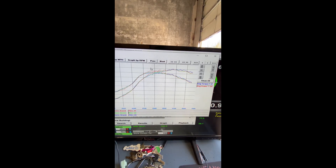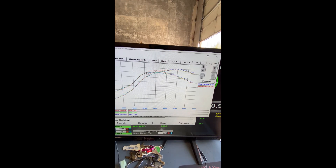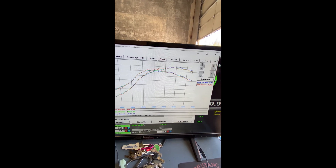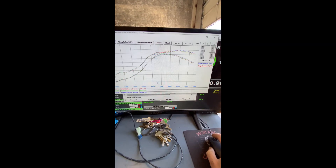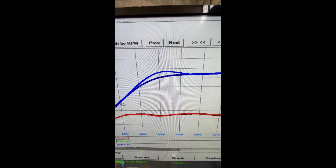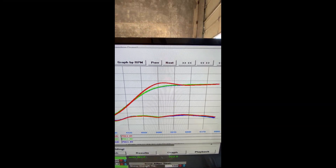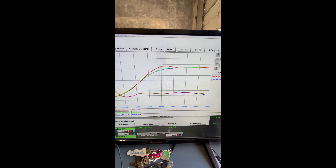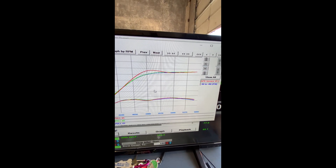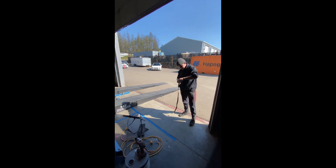Instead of it peaking at 24, we got a little more torque right there when it came in, but horsepower dropped off up top. I pulled it down to 21, which was the target for pump gas, and it made more power up top — so the car is happier. Everything looks good. Going over air fuels and boost curve: you can see that boost creep I was talking about on the first pull. I went ahead and took care of that. Air fuels are pretty good — they remain the same throughout the entire pull, so the tune was on point as far as air fuels go. Just the wastegate duty cycle needed literally like 5% trim. Got her all dialed in for you there, Brandon. She's good — she's ready to rip again.